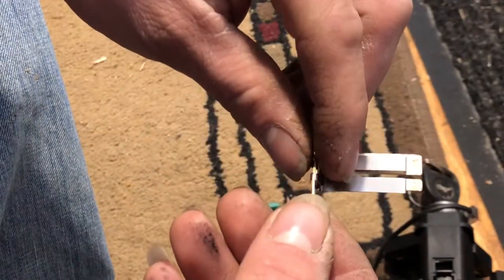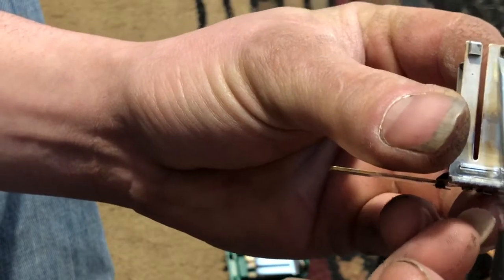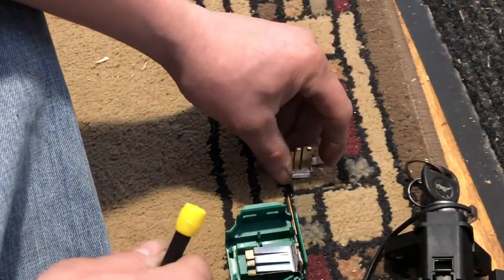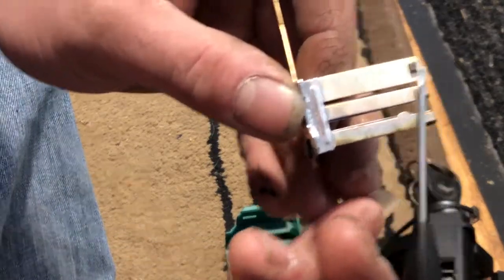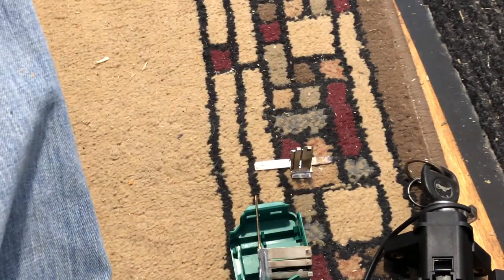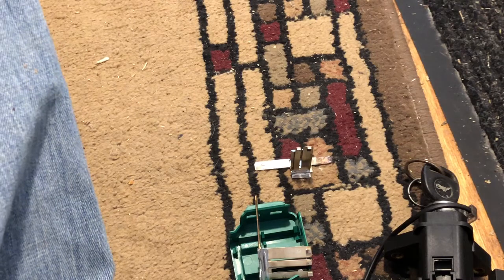This sits on top there, this is loose, and that goes against the plastic cover, so we're going to flip this back over. You can see that contact there is burned. The switch did have good resistance when I was checking it, but I do have some burned contacts which would affect things. That one's just got a tiny little speck. We're going to try to polish them as best I can without damaging them, so I'm going to go find some good sandpaper and I'll be right back.